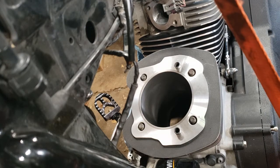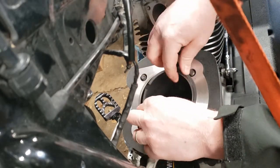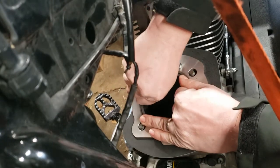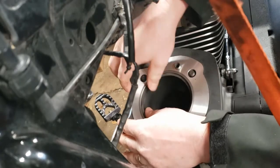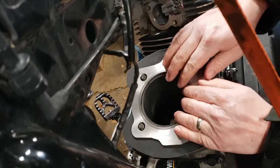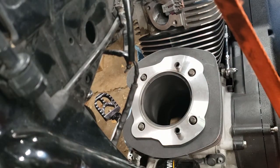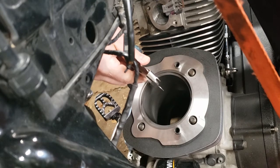You want to keep these separated so you don't lose them or get them screwed up. The upper ring gaps to the same amount - pretty much the same procedure, at least on this setup it does. Sometimes your piston manufacturer or engine kit manufacturer will gap the top one differently than the bottom one. Read your instructions that come along with your big bore kit - it's not just packing material, you're actually supposed to read the instructions. We'll start with 20 thousandths since that's where it was.